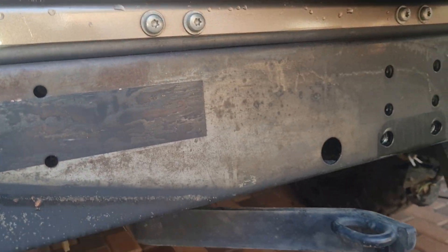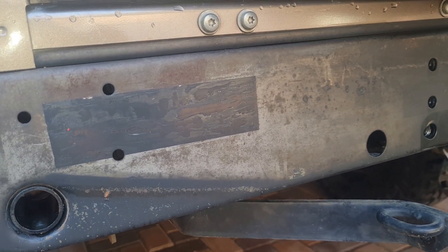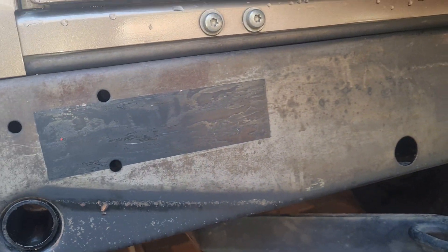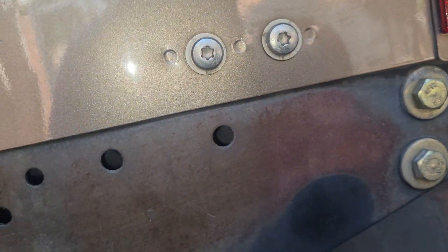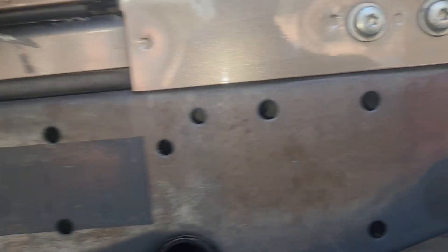This car is a 2013 model. It's in South Africa - it doesn't really get wet or anything like that. I just washed it and there's quite a lot of sand and mud coming out of it. Just check yours - it's all surface rust, but if you don't attend to it somewhere it is going to bite you in the arse. If I look at this piece here it's still on the surface, but once you leave it too long it'll start pitting.